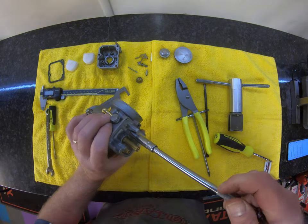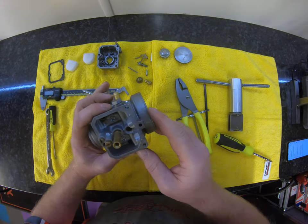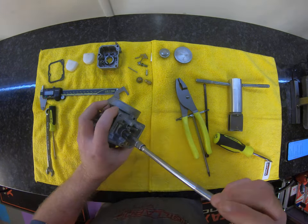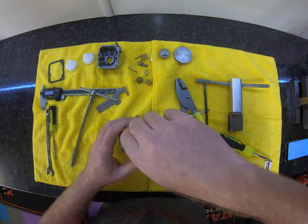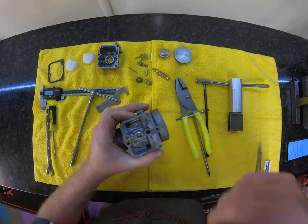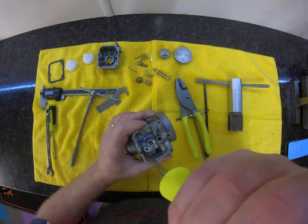9mm — that's it, we're off. That leaves us in here a small paper-type washer — be careful of that one. Take off the main. We're disassembling the carb now; just be careful and use the right size screwdriver so you don't damage the threads. It's only brass — soft metal. Put these to one place.